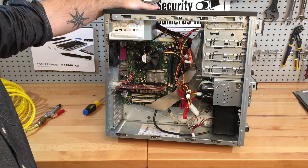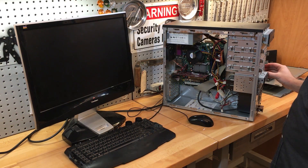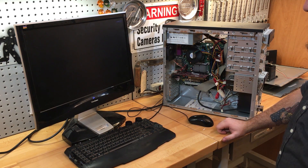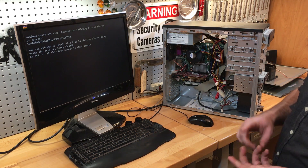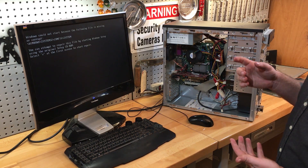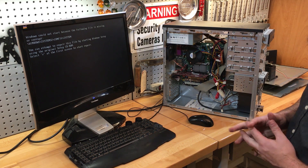Now that we've cleaned this out, let's go ahead and plug it in and see what it does. We got power — let's see if I can turn it on. Power's on. We have a video signal, we have something on the screen. Right off the bat we figured out the computer boots — well, actually it doesn't fully boot. It posts, it turns on and stays on, there's no smoke or anything crazy. But what you see on the screen right now says 'Windows could not start because the following file is missing or corrupt: Windows\System32\config\system.'